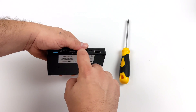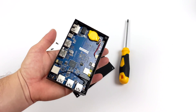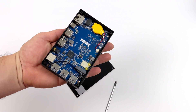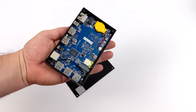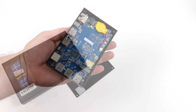I wanted to pull the bottom off of this mini PC — the bottom is made of metal. We do have a free M.2 slot here. It doesn't support NVMe; you will have to stick with an M.2 SSD, but you can go up to 512GB in this unit. Everything else is soldered to the board, so there's really no user upgradeability except for this extra storage.